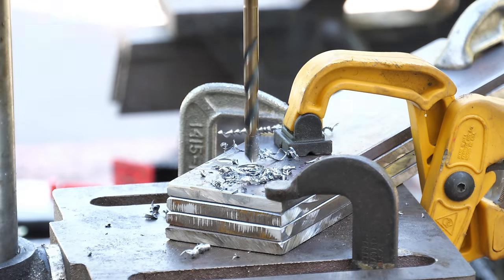Now that those are all in place, we can push the upper end of one of our shackles up into position and lock it in place with a through bolt. We'll leave that loose for now and get the lower end aligned with the leaf spring with its very own bolts tapped into place. That's one side taken care of, let's see if the other one goes as smoothly.